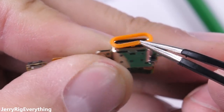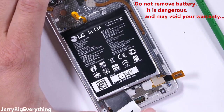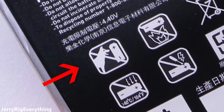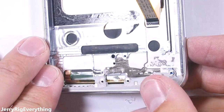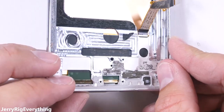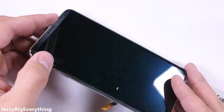The charging port has a huge thick orange rubber ring around the tip to help keep liquid out. The non-removable 3300 mAh battery is next — there are no magic pull tabs, but the adhesive is not destructive like on the BlackBerry Key1, so with a little force the battery pops up and out. You might have noticed the extremely small bezels on the 6-inch OLED screen. This was achieved in part by having the display driver IC flip around under the display and wrap up inside the phone. Removing the display from the metal mid-frame would destroy it, so I only attempt screen replacements if the display is already totaled.